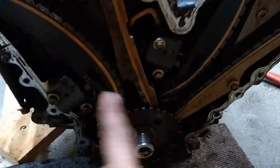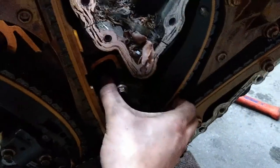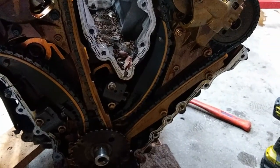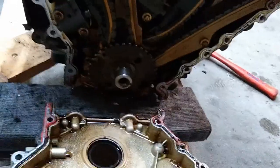If I go over to the other side of the engine where the tensioner has not failed, look at this — I literally can't squeeze it even if I tried. Compare that to this side, and safe to say that's what happened. And that is the side where we found the broken rockers, so yeah, I think that's what happened boys.